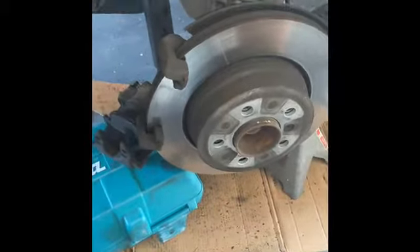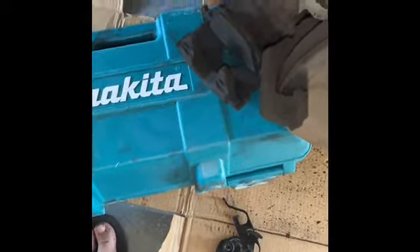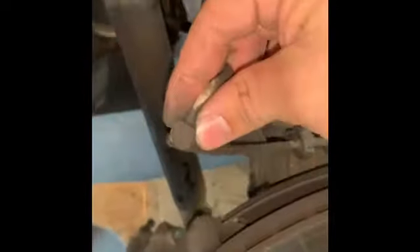Alright guys, I'm just finishing up over here with the rear passenger side. I wanted to talk real quick about these wear sensors. There are two wear sensors on this car — one on the rear passenger side, and one on the front driver's side. This sensor goes into the pad that is closest to the piston. You could pop these out — it matters which way it goes in. This side with the ridges is the sensor side. The side with the dot on the back or the flat edge goes towards the pad, and the side with the nub goes towards the rotor. Very carefully, it goes into that pad just like that — make sure I don't lose that clip. You could take a screwdriver and go along the edges of it and pry it out. Be very careful, because you don't want to break the backing part that helps secure it in place on the new pad. Hopefully that makes sense.